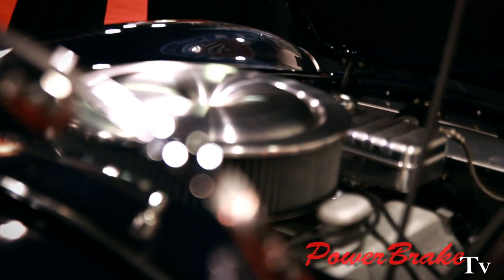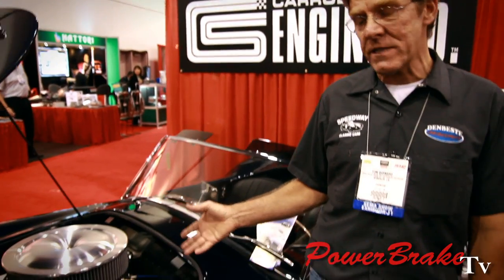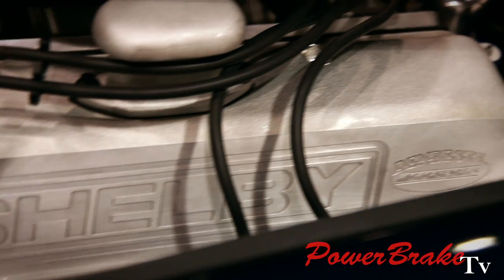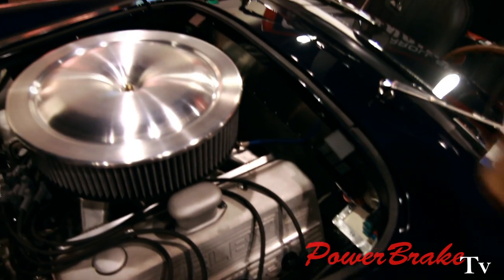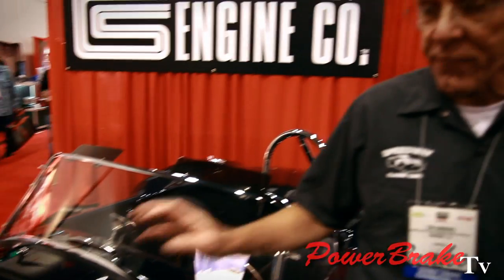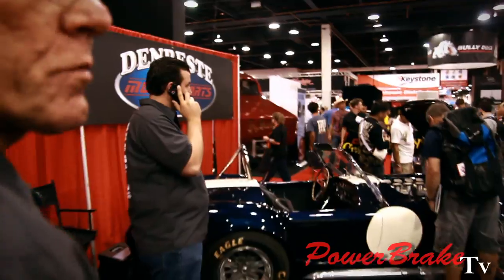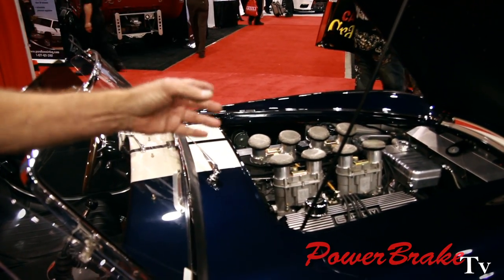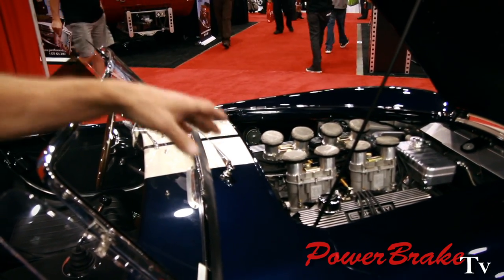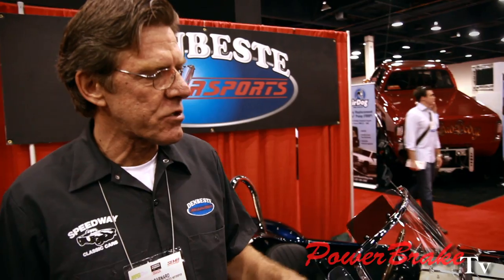This is one of the finished cars. This is actually the very first car that has one of the hemispherical engine motors in it. If you look down through here, you can see how much we had to modify the foot boxes just to make it fit, because of the width of the heads. This is the very first 427H motor in the first Shelby it was put in. Over on this side, we have a very similar car but with the 427 FE engine — it's called a stack 8 fuel injection unit. It looks like Webers, but it actually has the injectors inside. We mount the computer and all the relays in the trunk, out of the way, so you really can't tell it's fuel-injected. Very similar cars, just different engine packages.